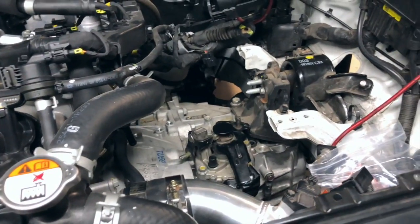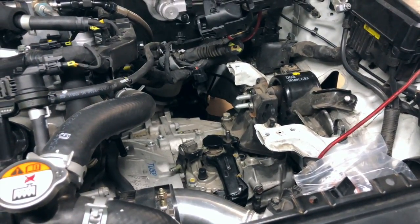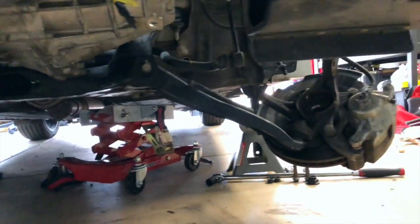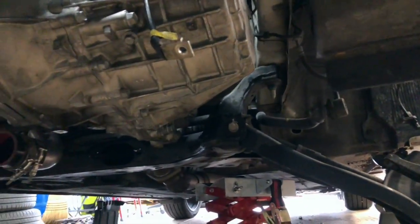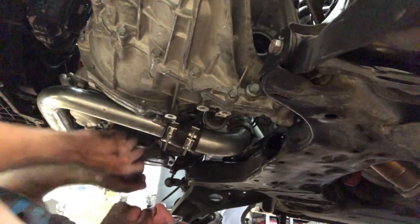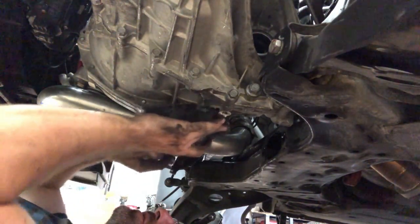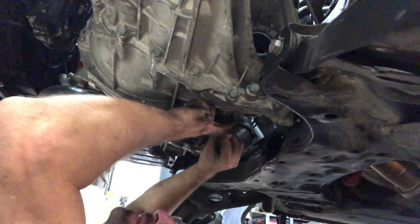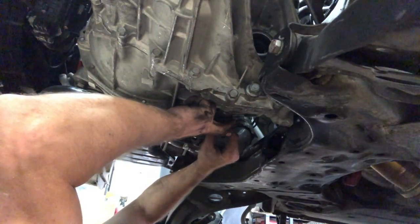And then putting everything back is just going in reverse of what you saw earlier. So you just gotta button up the hot pipe, clean up some tools real quick, and get the axles in. Okay, we're gonna put this tranny mount on. It only goes one way, so you can play with it and finagle it. If it doesn't line up to any holes, you got it wrong. So there's three bolts, they're 14 millimeter.